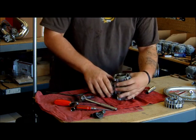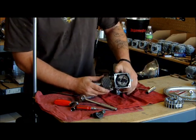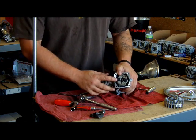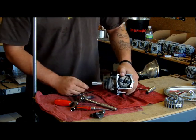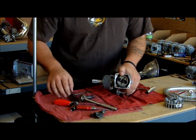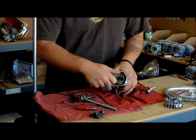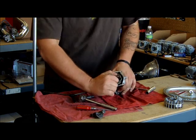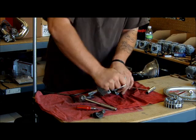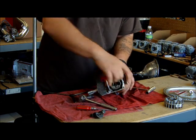Next is the clutch. There are other clutches out there — this is a NOAA clutch, which uses a 14mm socket to take off the clutch bolts. CY's use an M6 Allen bolt. Since this is a NOAA, we'll go ahead and take this off just like this. You still have your piston stop in because it's still stopping the piston. Take the pressure out, and that's it.